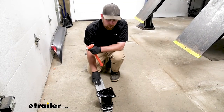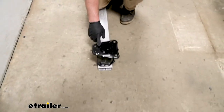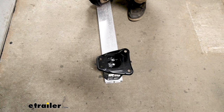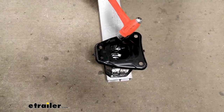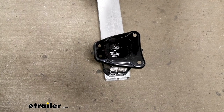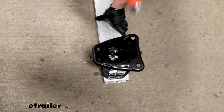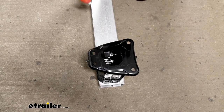Now we can move back here to our bumper beam. If you flip it over to where it goes flat up against the body of our vehicle, you can see that there's a tab sticking up there. What we need to do is flatten this down so that it doesn't interfere with the hitch. So go ahead and take a hammer — pretty straightforward — we're just going to bend that nice and flat. And we're going to do that to each side of our bumper.